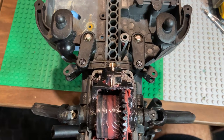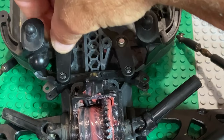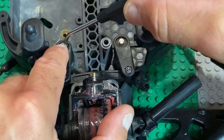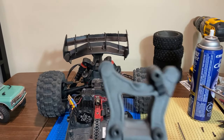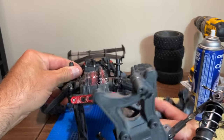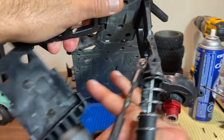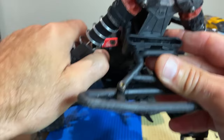Put your diff back in. Now there's one more shim to be installed — on the passenger side of the RC car. I did try both posts, but because that screw is so close to the right side, it bound up, and I found that if you have it contorted you'll actually rub on the drive shaft once installed. That's it — we're putting this car back together. The key point here is just to get those two tabs started first, then this whole thing will kind of flop onto the top of the car.